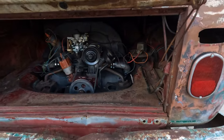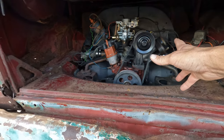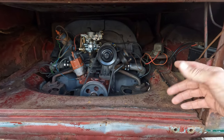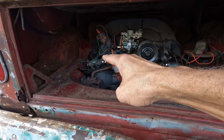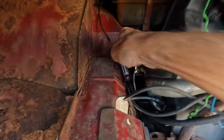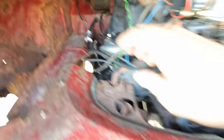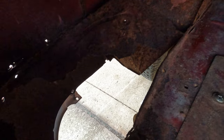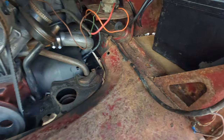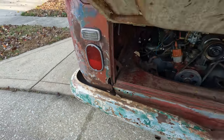Let's look back here in the engine compartment. It has a 1600 — somebody swapped that out, probably a '71 or '72. I think these had a 1500 originally in a '68. It starts, but it's missing a little bit. It still has some bad gas in it. You can see the filter right here — it's a little brownish, still pulling some garbage out of the tank. I had to pull the plugs and redo them. There's some rust where the battery tray is on the opposite side, so definitely need a new battery tray. I just have a piece of wood over there right now. Probably should do that panel at least.